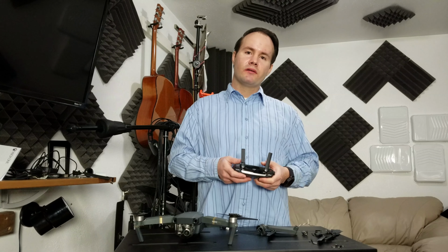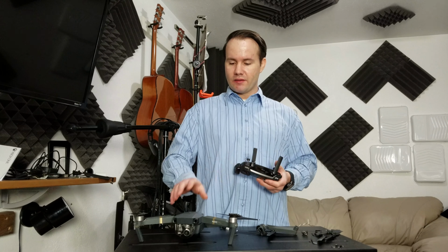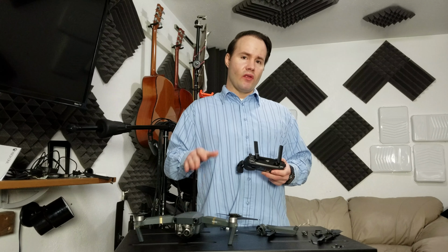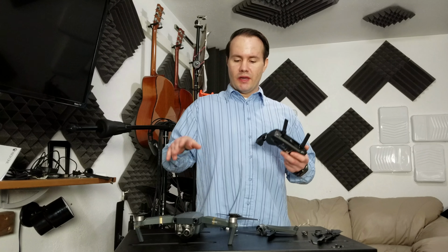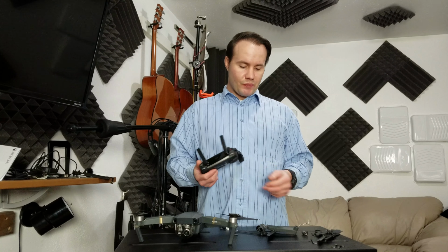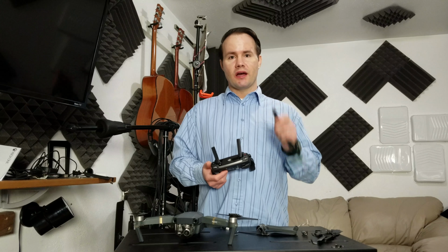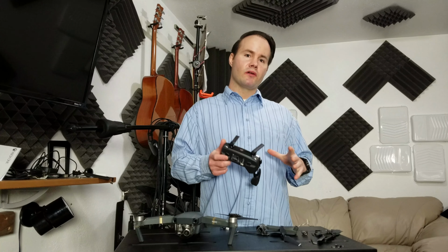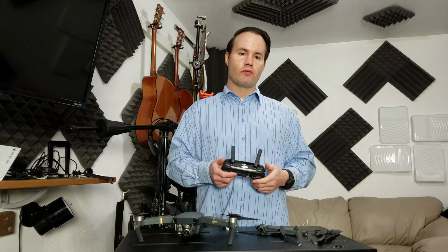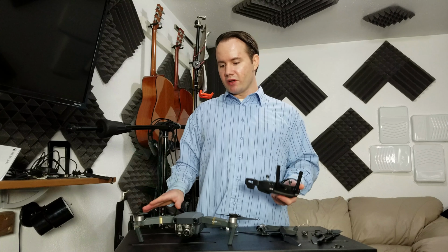You can go up to 40 miles an hour in sport mode, and it handles surprisingly well. It doesn't flip over like you would expect something of this lightweight. I have noticed on long distances it can tend to drift or get picked up by small winds and pushed off course, so it's not as big and powerful as the other drones, and these blades are pretty fragile. Having fragile blades means even touching a twig or a piece of grass, if it's thick enough, could potentially break it. Some of the other drones, like the Phantom 3s and Phantom 4s, have very thick blades which are robust. That's one of the things I wish they had with this, but I understand they have to be lightweight and collapsible. So there's a give and take with that part.